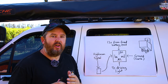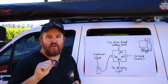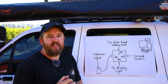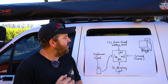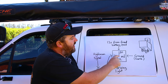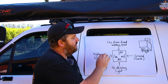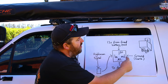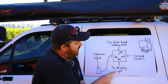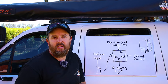Relays are designed to withstand the load coming from your driving lights, unlike your high beam switch or a dash switch. Most of them are around 40 amps — you want a 40-amp relay typically for a light bar or spotlight, and that'll handle the power going through there. The switching wire is only a trigger wire, so minimal load goes through it — the wiring doesn't have to be as thick. But your wiring from the main battery to your driving lights will need to be a lot thicker to handle the load going through those two wires.